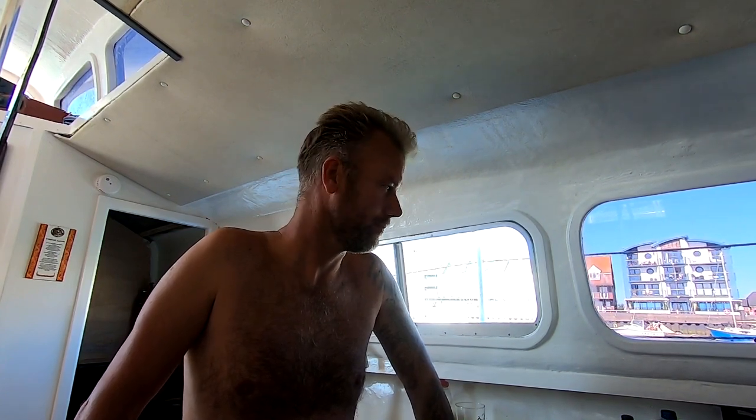As I was outside doing the windows, my friends were trying to go out in their tender. The outboard was barely running, so I couldn't watch it any more. I had to strip down their carb and do their spark plugs and stuff. Got it running sweet as a nut. And for payment, I said they can buy me breakfast.